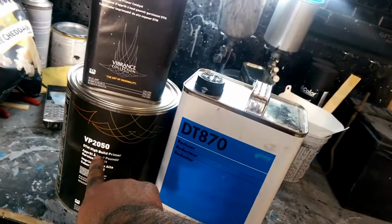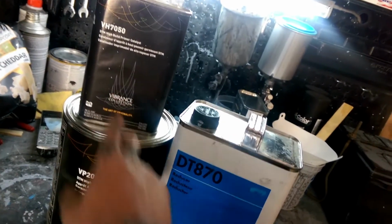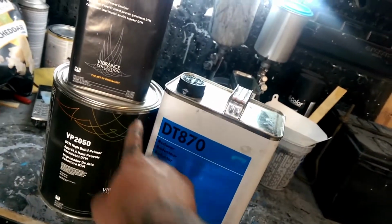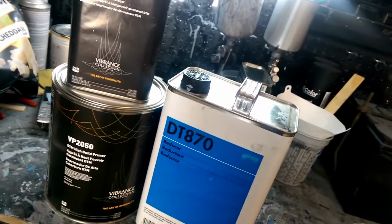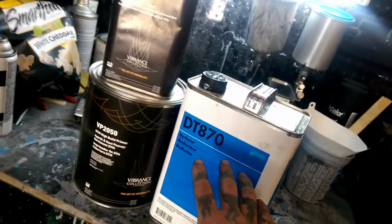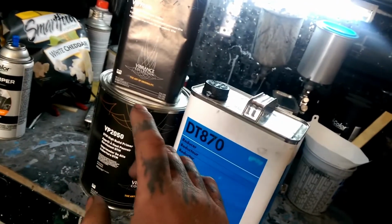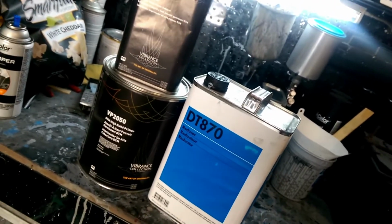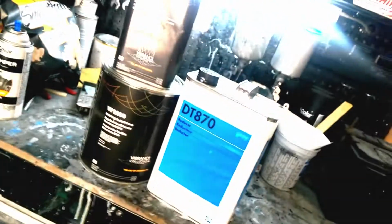We mix this 2 to 1. This mixes 2 to this 1 to half a reducer when you spray it. And they recommend a 1.8 tip, I think, to a 2.0. Ain't sure on that. I put it in the description below when I upload this video, so check that description out for all that information. So let's get this video started.